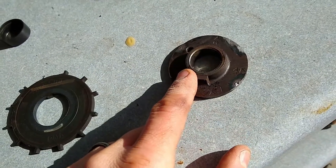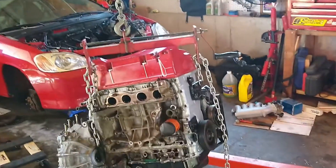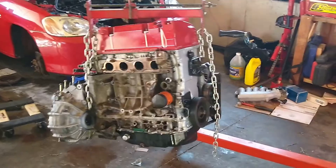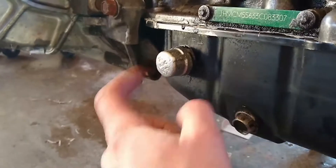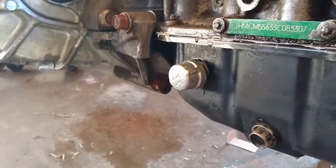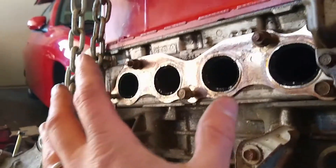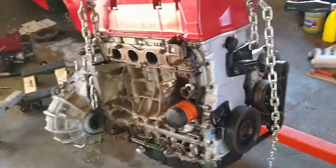So that's 12-minus-1 on the crank, and then a single cam signal for Megasquirt or Speeduino. I'm about ready to put this back in. I put an oil drain on here — it's just a half-inch nipple with a cast plumbing plug, a male half-inch fitting. That should give me a lot of options for however I want to run the oil drain. The turbo will be up in here and there'll be plenty of room to get it down on the side — I'm thinking it's likely to be closer to the driver's side. I'm going to see if I can get this thing back in.